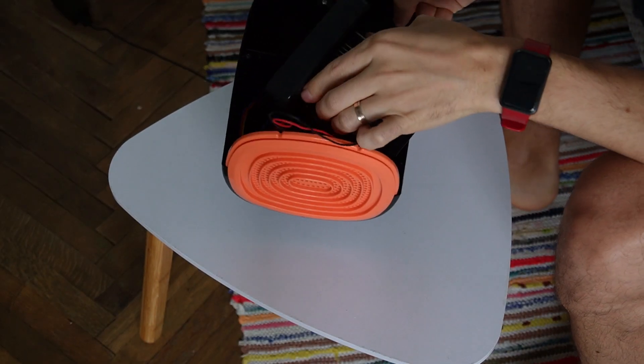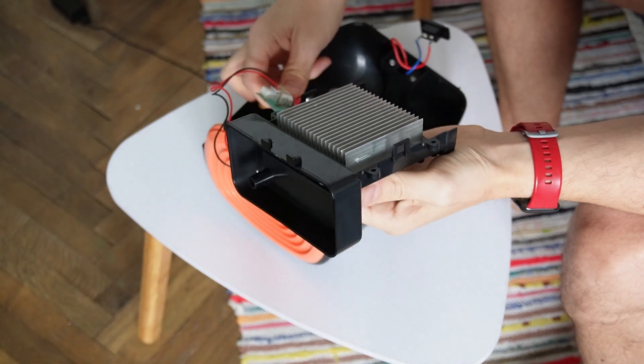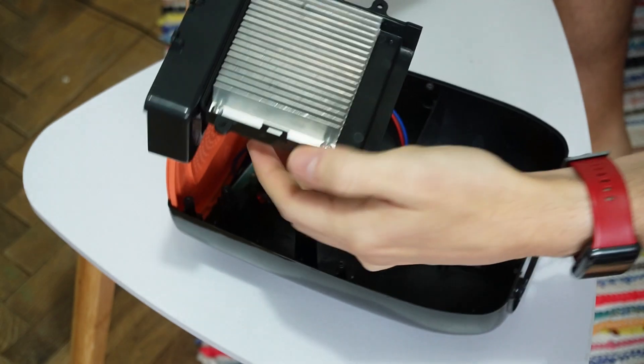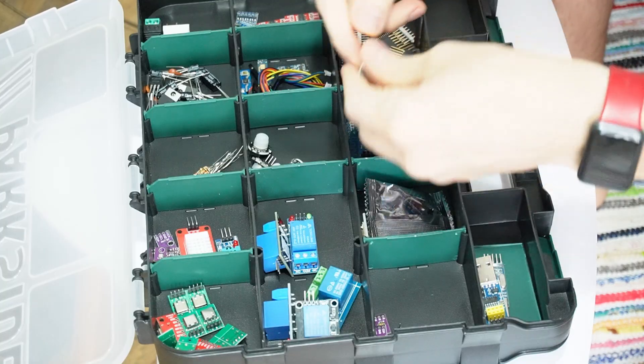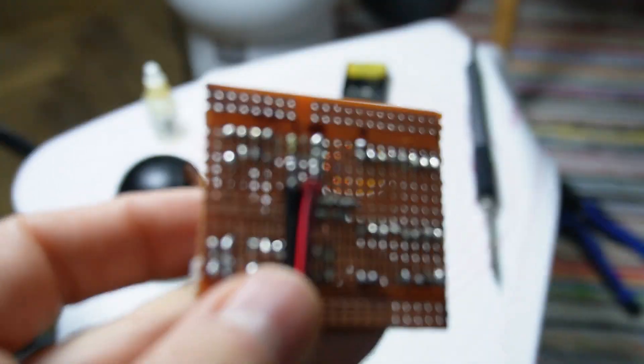Come join me on this journey to see what I did good, what I did bad, and where I should have thought twice before executing the plan. This is a really cheap dehumidifier I got from a local store here in Romania, but you can find similar models on AliExpress. It's fine for a small closet or small bathroom, but it had a major problem — it wasn't automated. My plan was to install a relay inside to control the Peltier module and the fan, add a temperature and humidity sensor, and replace the fan with a PWM fan. Disassembly was really easy and the circuit board was basic, so replacing it with my own was straightforward.